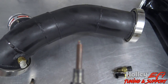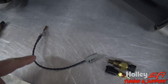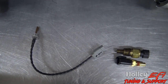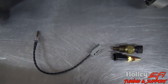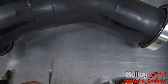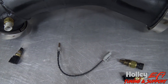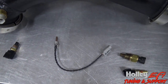It's 1/16 NPT and it actually goes up to 600 degrees. It comes with a little flying lead, already terminated to a Deutsch DTM-style plug, and then it comes with the mating receptacle and terminals for it. I've made other videos on how to crimp those pins, but it's very simple. This is a replacement and upgrade for you turbo methanol guys. I'm going to show you how to set up the sensor data for this sensor and the coolant temp sensor — Greg and the guys over at Hyperactive have all the sensor data for all EFI systems, not just Holley EFI.